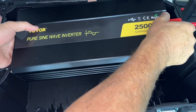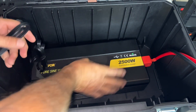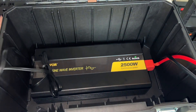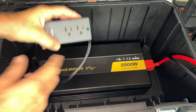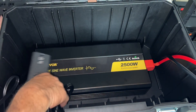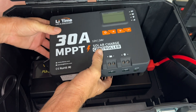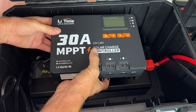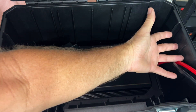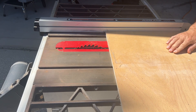Let's figure out how we're going to lay this out. We've got the large inverter — we're going to install it right down in the bottom to give space for cooling around the sides. We'll need to install a cooling fan in this box for sure. We have our little outlets, and we're going to put the MPPT charge controller in a neat way so it's easily accessible with plenty of room for cooling below. We'll also install our Anderson connector on this side.